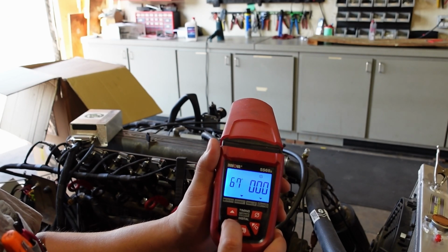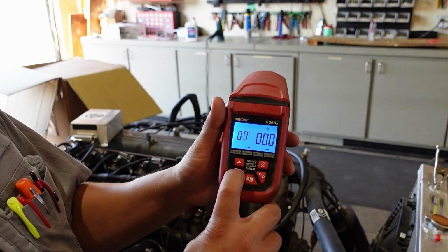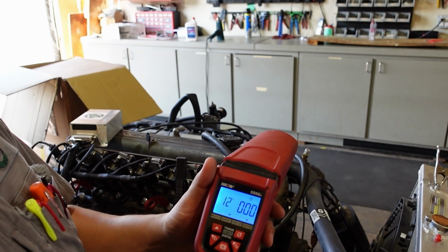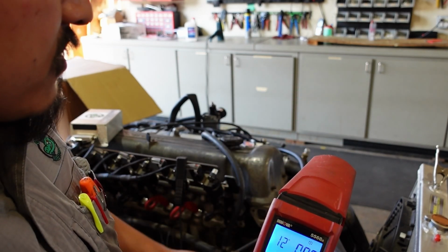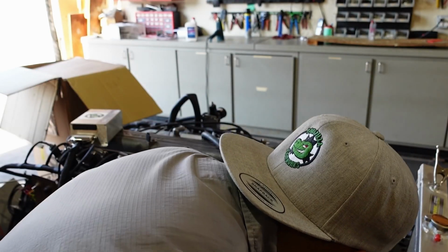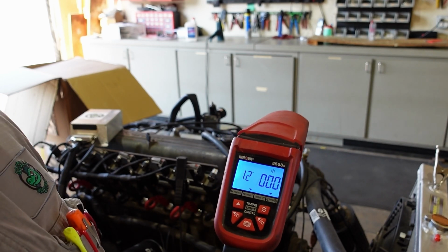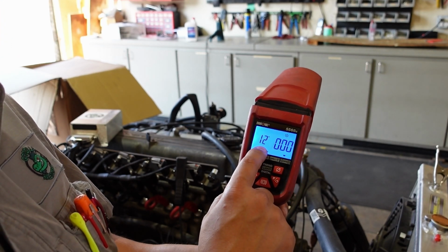The second thing that needs to happen is you need to preset your advance. The reason we do it this way is that it's just easier for our internal purposes. You don't have to do it this way. We preset the timing light to 12 degrees, which is what you should be firing when you're cranking. So the computer is pre-programmed to 12 degrees. If you have 12 degrees programmed into your timing light, all you have to do is line up your 0 marks. You don't have to get confused and try to find where your 12 is, because the factory timing plate just doesn't have as much resolution, or you may not have as much access to it, right? And a lot of modern cars only have the top dead center mark. So if you set your ignition advance to match what's commanded in the ECU, all you have to do is line up your top dead center mark.